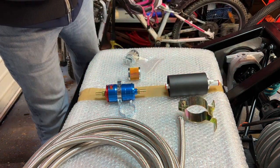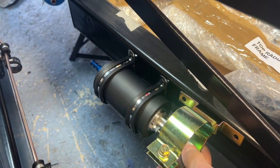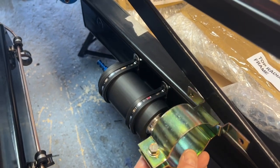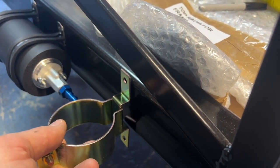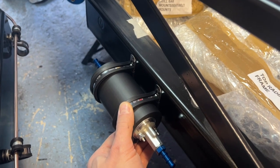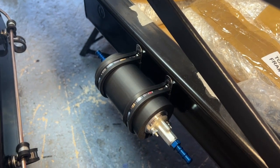I've decided to use a slightly different system to mount my fuel pump because I wasn't sure the bracket and flange would clear the driveshaft or the gearbox once fitted. Many brackets have mounting parts that don't have enough width on the frame to fit both mounting holes. So I've gone for 62mm P-clips — nice and tight, nice and firm. At least one fuel pump manufacturer sells P-clips with the pump, so I know it's a recognized fitting method. I just tapped some holes and I think that's a much better solution.